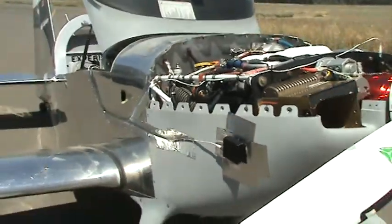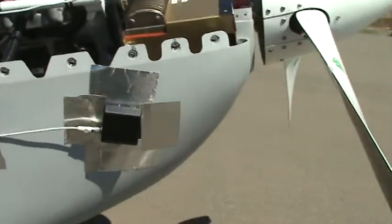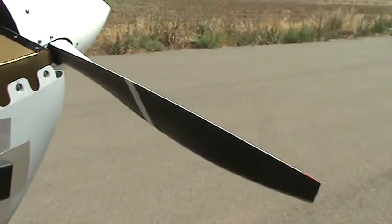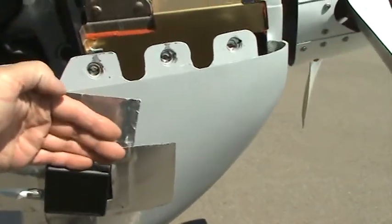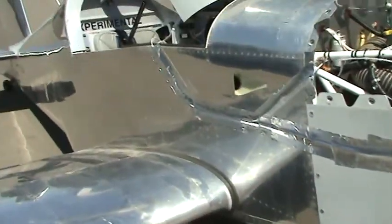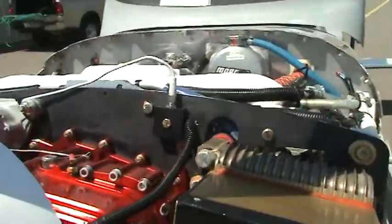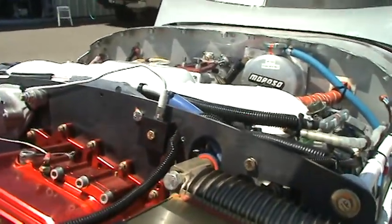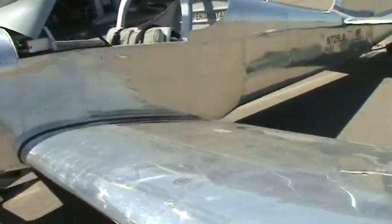I don't normally fly this at takeoff power and I haven't had it up there yet, but that's the setup for you guys to see how it's done. There's the blade tape right here, the optical transducer — I used a laser level right here to line it up and sight the prop. Just get some high-speed tape and tape the leads down. That's the coax cable. I mounted the transducer right here where the old vent tube went — it's a quarter-28, but you could tap the block to use anything else you wanted.